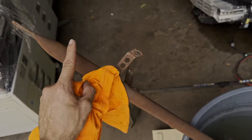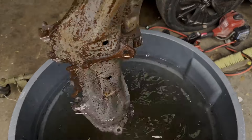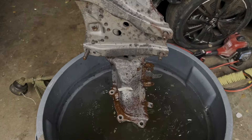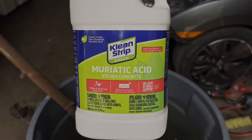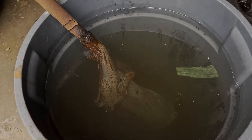We've been working on the '86 Toyota Corolla support bar — the rusted one we pulled out from inside the car. Here's a quick update: you can see what it started off looking like — really rusty. Now the majority of the rust is already coming out. The key ingredient is muriatic acid. We filled up a 32-gallon container, threw in the muriatic acid, and it's looking really good. Of course, whenever you're building a car, you run into things and you're battling in your mind — should I or shouldn't I? And I should. Let me show you what I'm talking about.